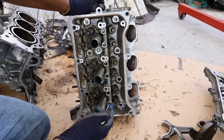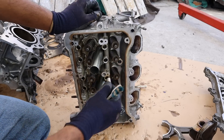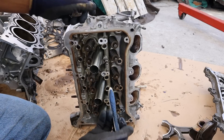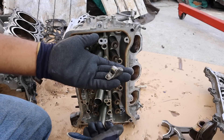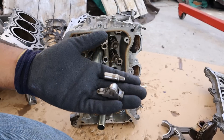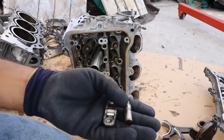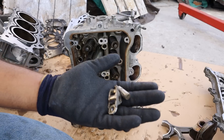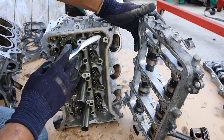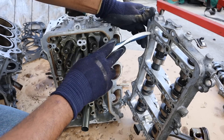At the top of the head you can see there are two main oil galleys that run the length of it, and those are going to house these little hydraulic lifters. Just due to the oil pressure, it's always going to try popping the lifter out against these little rollers so that it can always keep pressure against the camshaft — so you don't have to do a valve adjustment. If you are getting a little clatter at startup from the top end of the engine, it's probably due to these hydraulic lifters not getting enough oil — just wait a little bit for the engine to warm up and it should go away. The feed from the block for the valve train components ends up over here and interfaces with the valve train assembly.